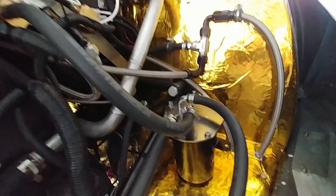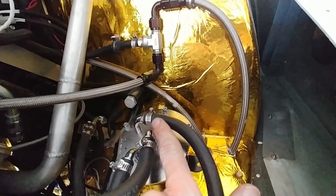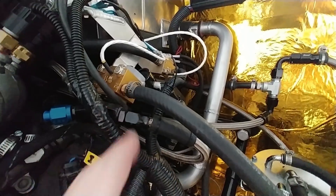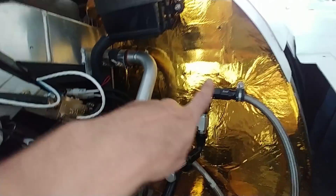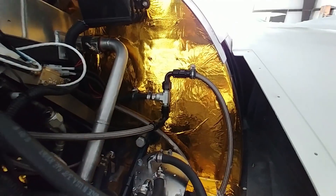You can see the pump just sitting there for now. The feed coming from the lift pump goes into one side of the filter, and the return coming back from the rail goes into the same side of the filter. After going through the filter, that goes to the main feed, and there's my flow sensor there — all plumbed in. Looking at the back, there's the main return that goes through the sender and is teed in with the heater loop going back to the header tank, so all that didn't have to change.